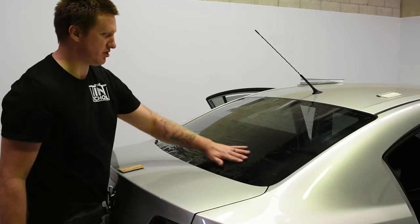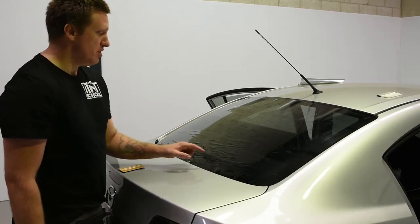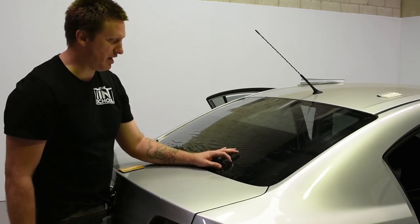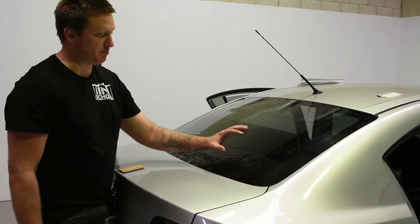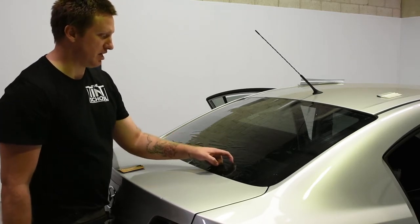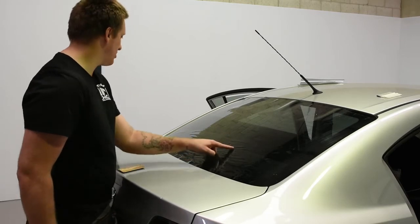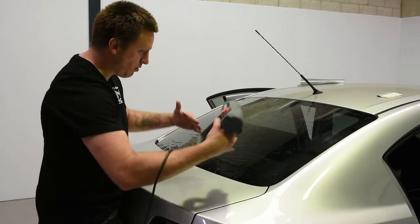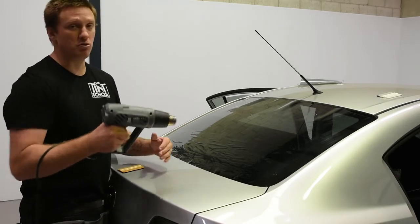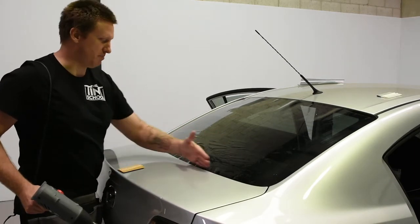You're going to see it's ripply still — there's no water under there. It's not going to sit down perfectly; it's going to look like it's raised a little bit. When you run your finger over these ripples, as long as they're smooth, that's a good thing. If you're running over them and they feel quite hard, that means it's over-shrunk and that's a potential problem when you get on the inside. We call these 'smileys' — they're small, probably three to four centimeters. But if you're heating and that smiley's growing, the window's laughing at you — it's telling you too much heat. Move the gun away and you can save the window. Now at the bottom, I can hold the gun a lot closer to make sure I get this sitting flush.